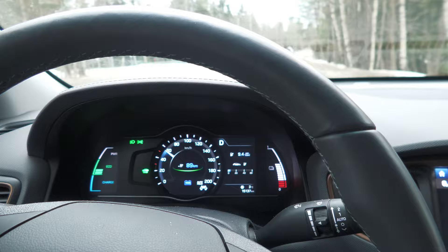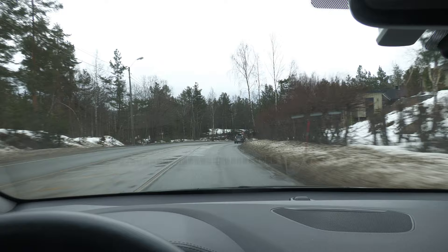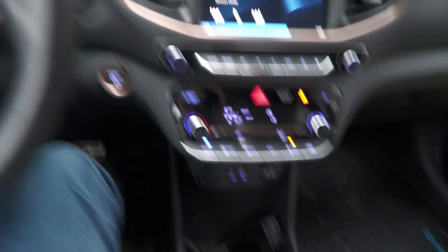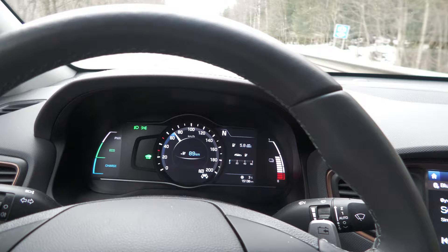I have to wait until I don't need to hit the throttle anymore. Now I'm going to sail down a bit — it's still regenerating. So if I just hit neutral, it disengages the motor completely. Now I can't press the accelerator, but also when I brake it uses the friction brakes. You can see there's no regen. So going down this hill I'm cleaning the brakes.